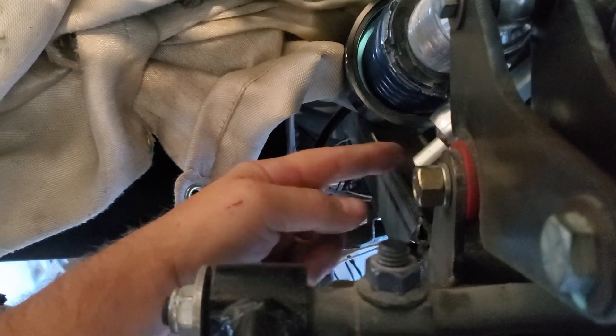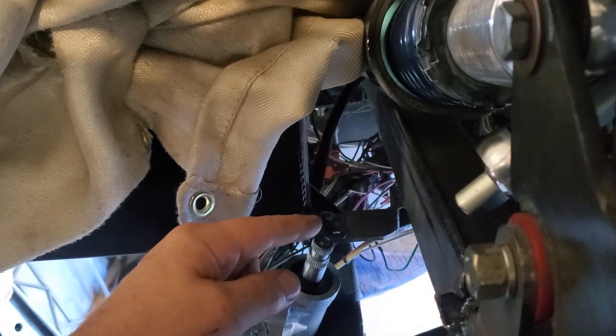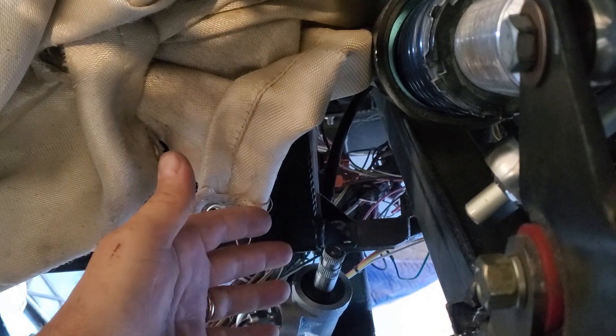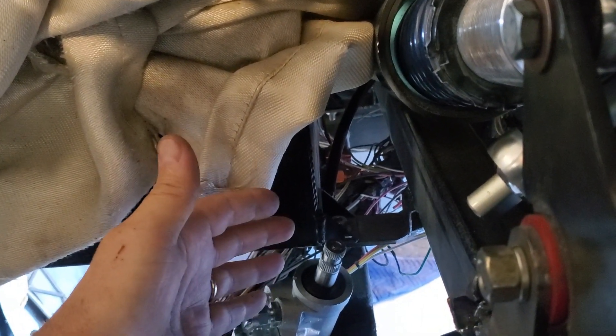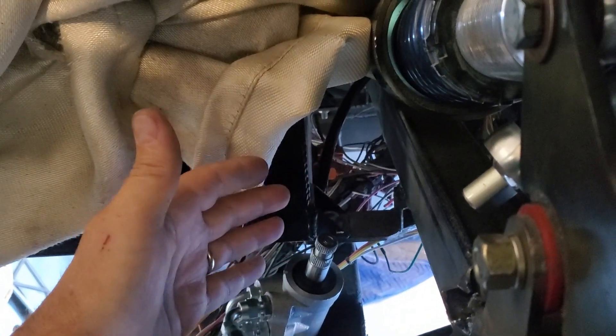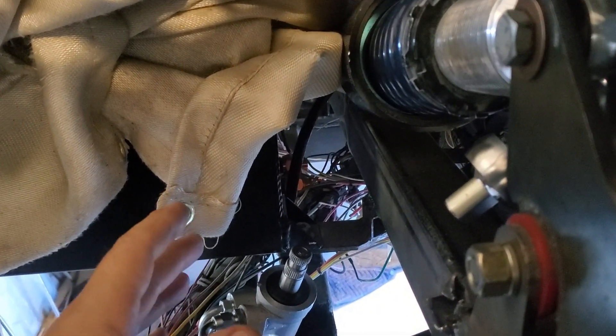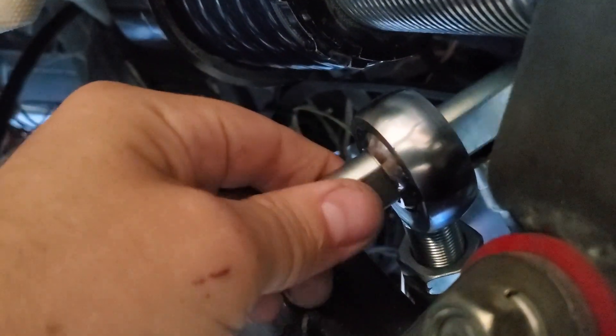We have to get it from here down to the rack, so I'll have two more U-joints. I had five before — this will cut it down to four. I could get one of those 90-degree geared steering things I found online, but they want $900 for those, which is just insane. So I'm going to try this, see how comfortable I feel with it, make sure it's robust, and hopefully that will sort out the steering. Let me know in the comments if there are any other solutions that aren't cost prohibitive.